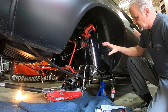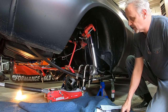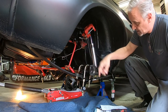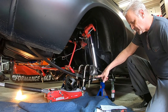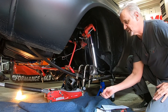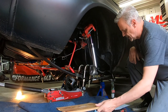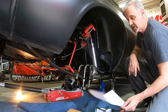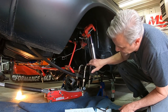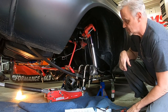It's kind of nice out so I opened up the door for some good light. The rear end is completely bolted down. I used a couple of 9/16 wrenches and got the upper sway bar mount put in. Next we're working on the center section. The kit didn't come with washers and I'm a fan of washers, so I bought some 3/8 stainless steel washers to bolt in the center section. I also bought a gasket, but if you read the directions they recommend using RTV silicone instead. The center section is on the jack — my friend Matt is going to run the jack up while I get under there and steady it, and we'll slide it right on.